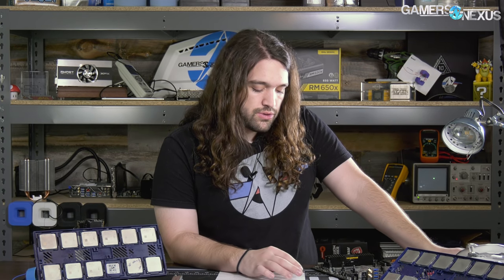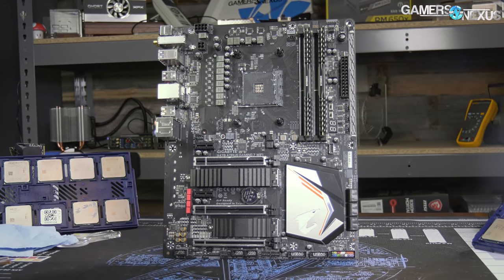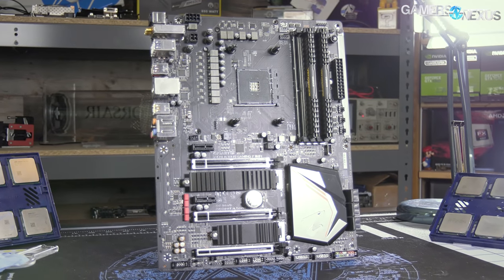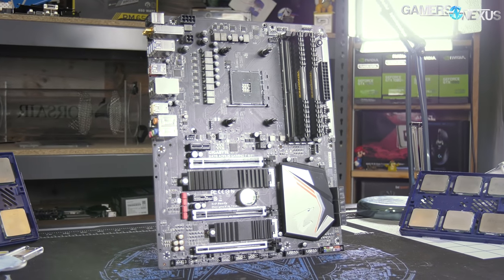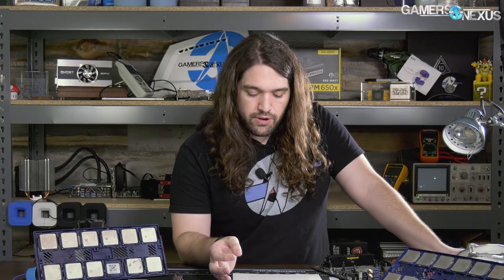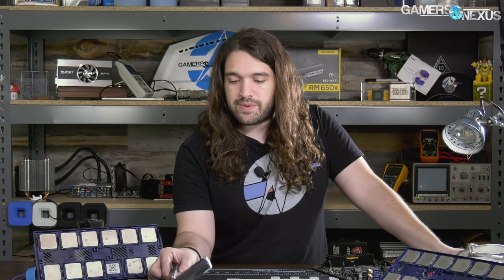As for the power going through these, Buildzoid has a video on our channel covering current ratings, theoretical voltages, and watt draw. There is a bit of an exponential voltage curve as frequency increases — once you start hitting 4.2GHz, the curve basically goes exponential, so you run into voltage walls before you run into cooling walls with the VRM anyway. Ryzen 2 is certainly power hungry but it's got limits. Well done on the VRM cooling and the VRM in general, Gigabyte — the whole thing is good in our books. The heatsink is completely unnecessary, but we're not going to be mad about it.